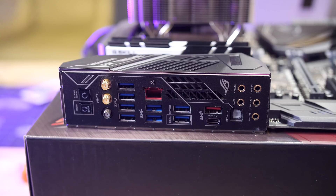At the rear panel, the I/O shield is pre-installed — no need to install one yourself. The wireless solution is Bluetooth, 802.11ac in a 2x2 configuration, and 802.11ad in a 1x1 configuration. I believe this is the only Threadripper motherboard with this type of high-end wireless solution. We've got eight USB 3.1 Gen 1 ports, two USB 3.1 Gen 2 ports (one Type-A, one Type-C), and an Intel Gigabit NIC. The audio codec is based on the Realtek ALC-1220 but features high-end ES9018 digital-to-analog converters for much cleaner sound.